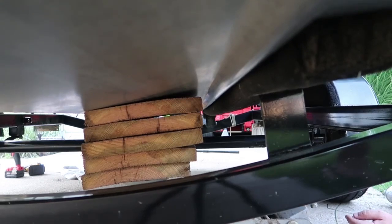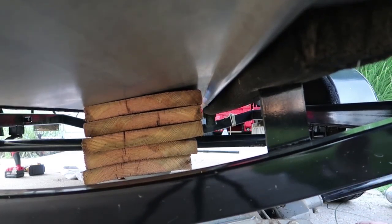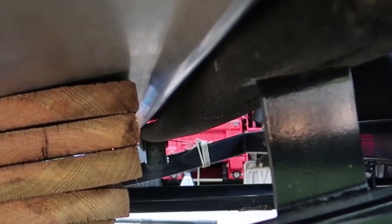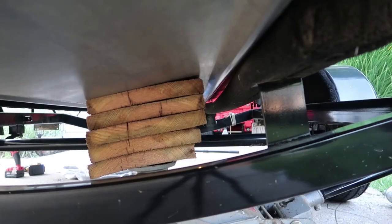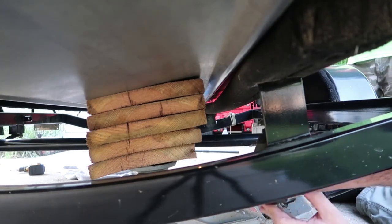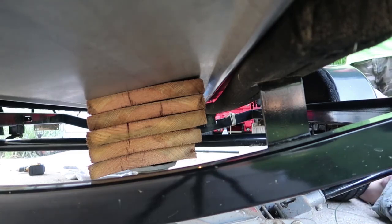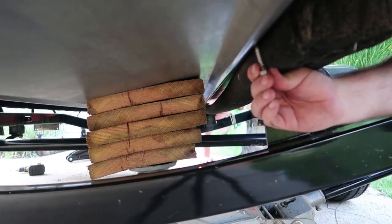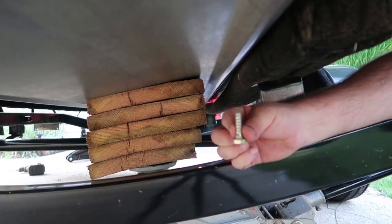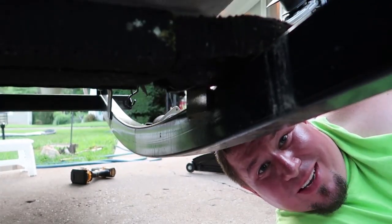You can see the wood actually levels out to the boat, so you're not putting stress on a small area — you're spreading it out. The pressure's already off the back, and now the pressure just came off the front. That's all the further we want to do it, because if this thing slips and falls we don't want it to fall too far. We got the front ones undone, now we'll do the back. As you can see, all these are is 3/8 inch lag bolts — they simply go up through the frame and into the wood. It's not thick enough to go through the wood and puncture the boat. So these are what we're using to hold the bunks down. If the bunk wood on your trailer is doing something similar to this, it might be about time to get rid of it.